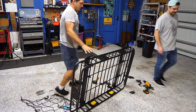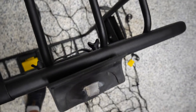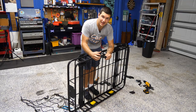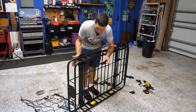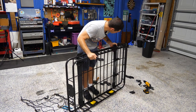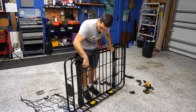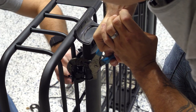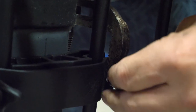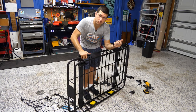It looks like you have two options. One way is brute force — just make it work. The other way is to eliminate the spacer. They come with spacers where you basically lock these little support bars into the channels and tighten it down to the cross member. If you eliminate the spacer, you have a lot more space, but it may have the ability to slide around. The way we went with it: you literally take some channel locks, squeeze the living hell out of the U-bolt so it deforms slightly — but honestly, who cares — and then you can get both of them screwed in. Since our cross members are already installed, we just need to go get this put on top of the rack.